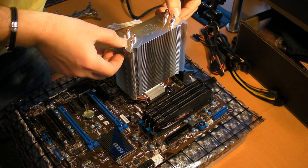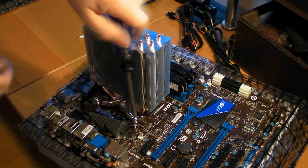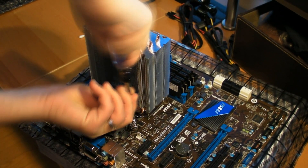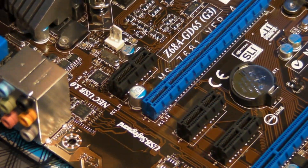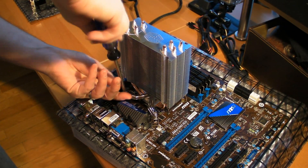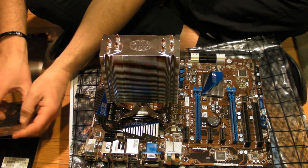There you see my dad mounting the cooler, and I helped out eventually. Then we're going to screw it in — this is a pretty easy part. One thing to remember is to do opposite sides diagonally; that's a rule of thumb when building a computer. This is also sped up. At the end of the day, it's not coming loose, so don't tighten it too tight — just enough so it stays in, because over-tightening might strip other bolts if you try to loosen them.